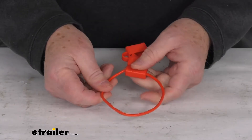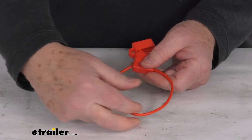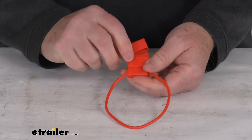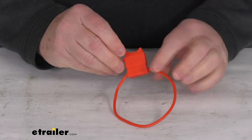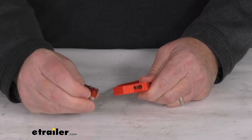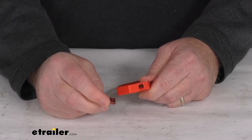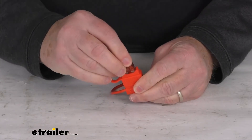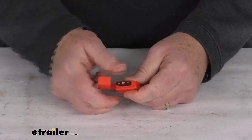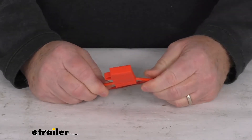To install this holder, you can see it's a single loop design. You just cut it where you need to, then connect the two ends to the wiring inline, and then install your fuse for protection. There are two holes — here's a 10 amp fuse — you just take the two tabs, line them up with the two spots, and push it in all the way to give you protection. Then put the cap over it and it'll protect the fuse from any damage or from the elements.